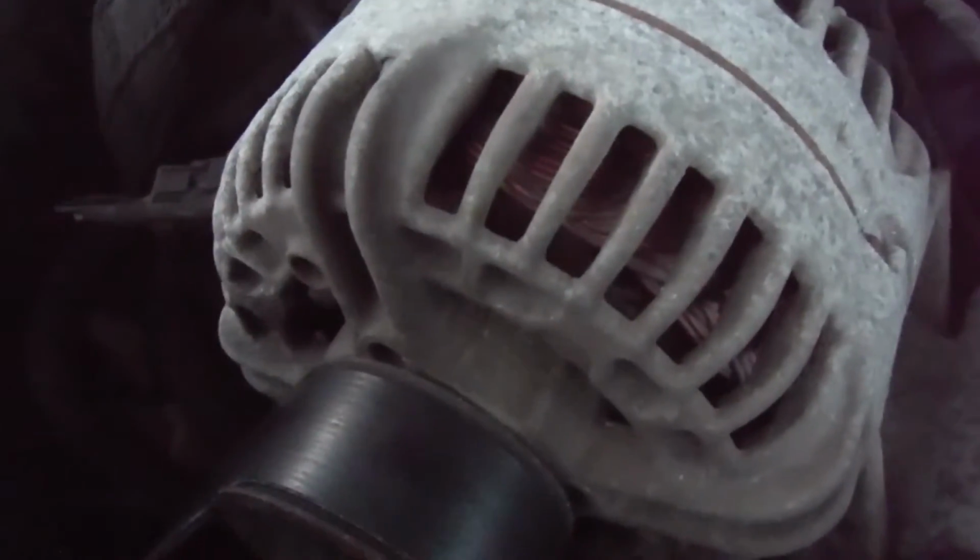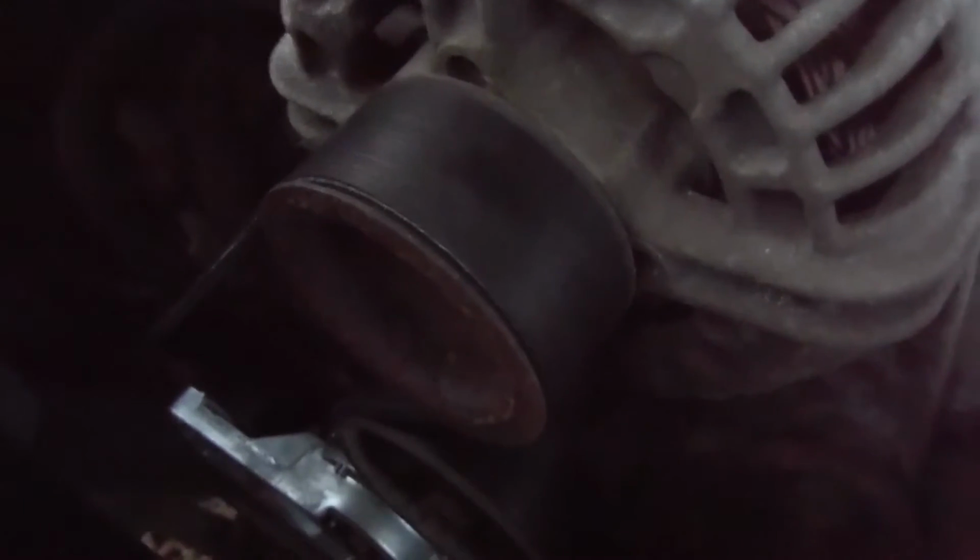So that's pretty much it. I noticed that tensioner was bad. And then I turned the vehicle off and looked again, and it was very, very obvious that that tensioner had broke. So, a little quick tip, whenever you think your alternator goes out, and it's still good for a little while, that was the best thing about anything with a pulley going out, is that one right there, because that is probably the cheapest. And since I've got like 140,000 miles on this vehicle or something like that, I decided it was also time to put on a brand new belt. That's why this sucker looks nice.